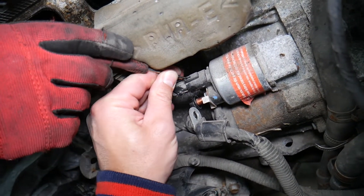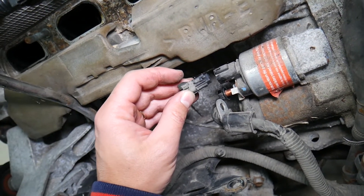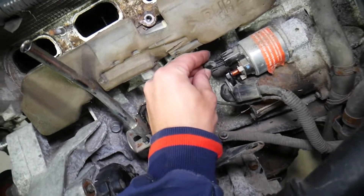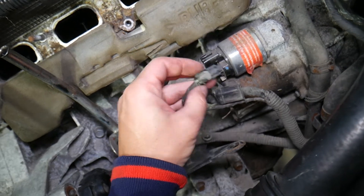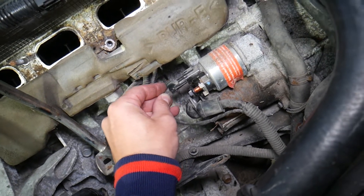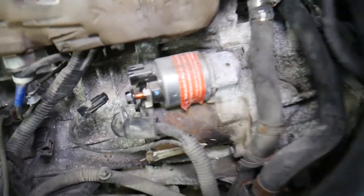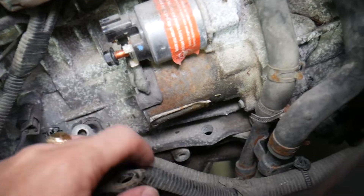This is the clip — you press down and pull it out. If you have a car that doesn't crank, always inspect that clip because that could be the reason. For instance, ours can just come loose, and if somebody installs it loosely and you hit a bump, it can easily come undone and cause your Hyundai Santa Fe not to start. You can see quite a bit of rust on that engine starter.